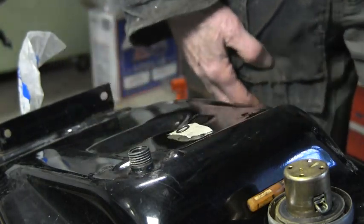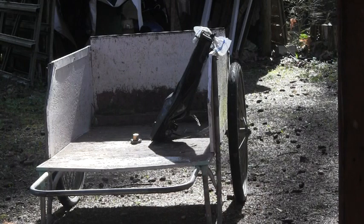I have the tank flushed — I flushed quite a bit of rusty crud out of it. I attempted to take the level indicator out; I got it off mainly to clean around it and see how the gasket was underneath. I got everything apart but I couldn't get the sending unit back on — there must be some sort of trick. I'll probably do an in-tank test where they hook a wire on the inside and do a resistance test. But it's clean now and I'll get the o-ring for the outlet and put that back together.